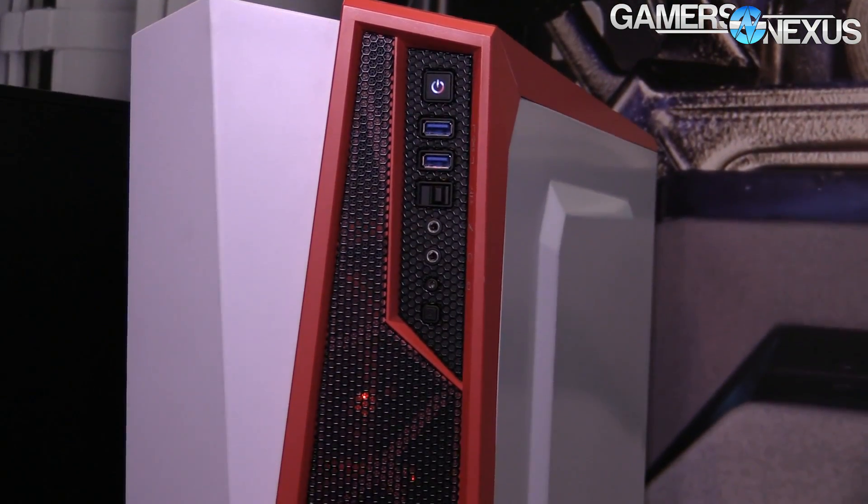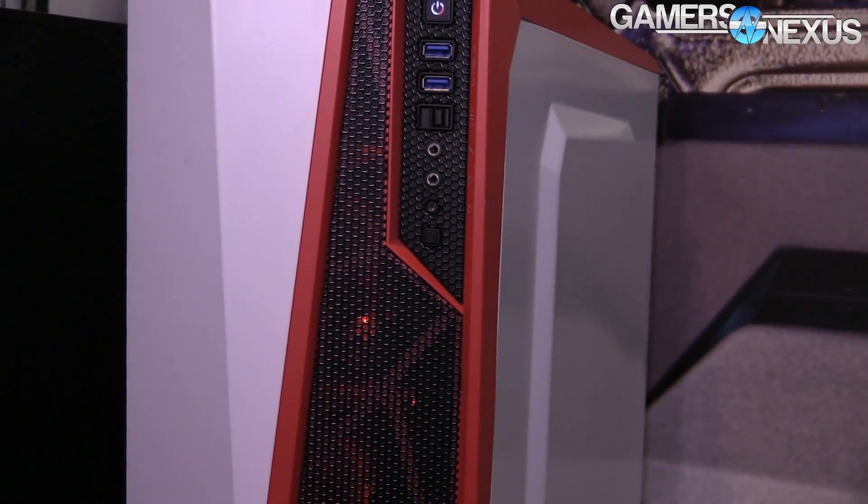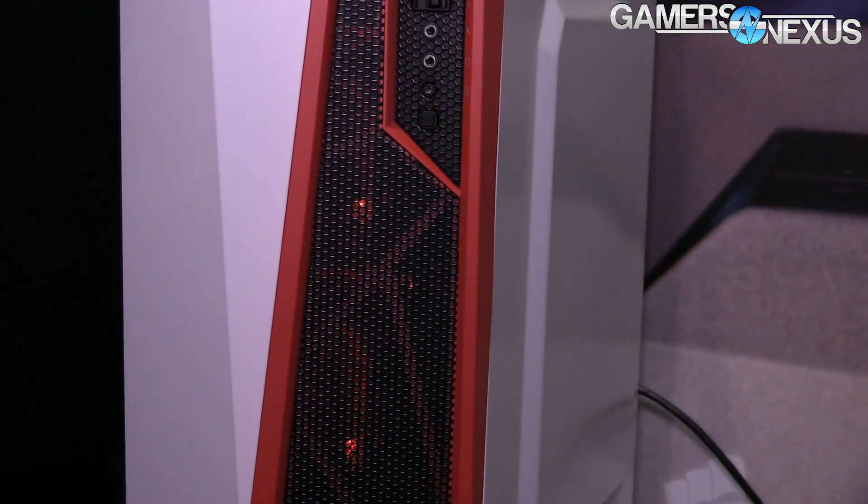One of the big things you can tell just by looking at cases is the thickness or rigidity of the steel — how does that impact the user's perception or experience? A lot of people will take a case out of the box, say it feels really sturdy, and most of the time that's based on weight. But the opposite is kind of true: it's not so much weight as it is rigidity. The torsional rigidity — if you take a case like this and try to twist it — is how you actually see how well it's manufactured.